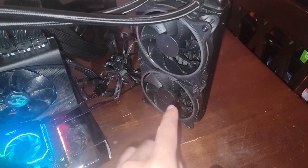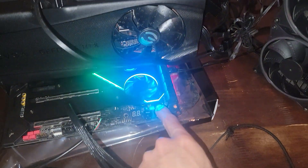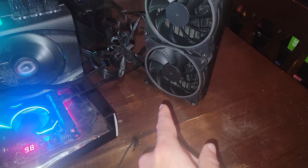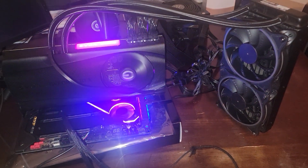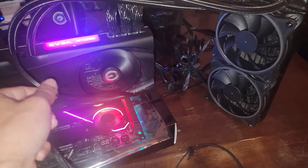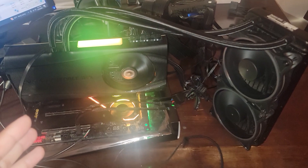Here we are — we've got everything hooked up. Both of these fans can connect directly to the hybrid cooler because that fan is getting powered directly through the PCIe slot from my understanding. Now we've got all three fans that should be spinning here in a second. One of them is spinning; we'll have to check the other one and see what's going on and what's controlling them. These two might not engage unless there's a significant thermal load.